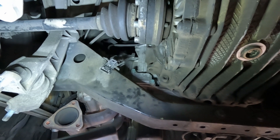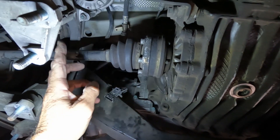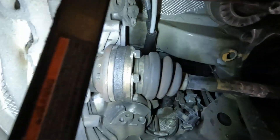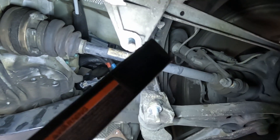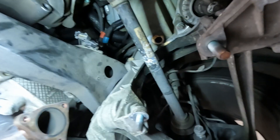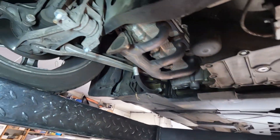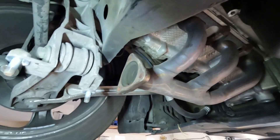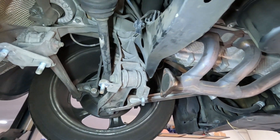Tomorrow we can start to take apart the gearbox. We'll remove the drive axles and tie them up — the boots actually look in pretty good condition. There looks like there's a leak here, but not too bad, so maybe I'll leave those. There's some kind of leak coming from above, which is where the coolant reservoir is — and that's known to crack, so I have to investigate that. I am amazed that this car wasn't throwing a code because the oxygen sensor wasn't even screwed in — it was just loose.